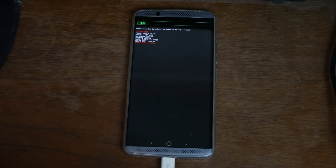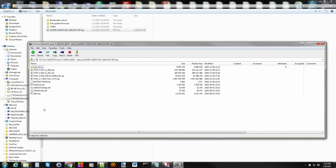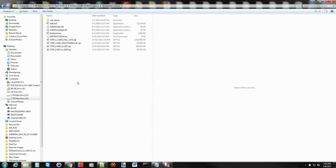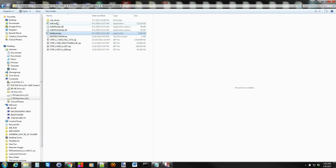Let's go over to my computer now that we're plugged in. Let me just show you what I've got - I'm going to give you a link to this file right here, and this is what you need to unlock the bootloader. It contains everything. When you extract it, it looks like this - all of these files extracted into my unlock bootloader folder. Here are the five files you're going to put on your card, here are the directions, and then you have fastboot ADB files here. And lastly you have drivers if you need those as well. This contains everything you need to unlock the bootloader and even get yourself back to B29 or B27, depending on what firmware you want.